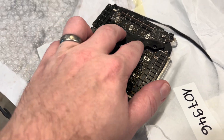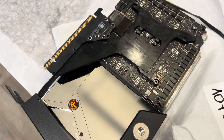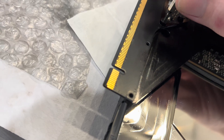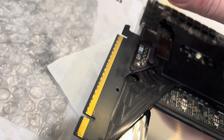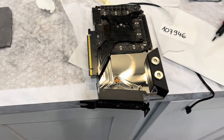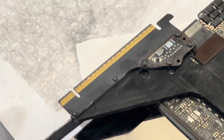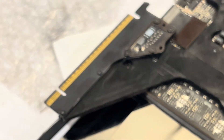All I did was lay our little plate on with four screws, then put in our four screws around the PCB. We plug in our IO, which is our input-output cable, and then go ahead and plug in our PCI Express, which is a modular PCI Express plug on this card. Once the PCI Express connector slot is screwed down, you've got six screws holding it with a little brace — it is extremely solid, not flexible at all. It's mounting down to this thick aluminum plate that goes through the PCB and keeps everything nice and rigid.